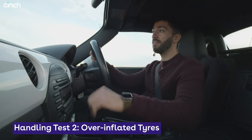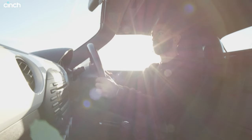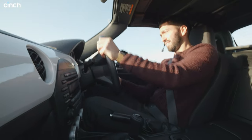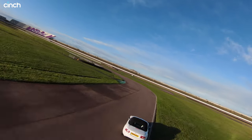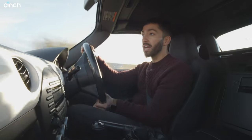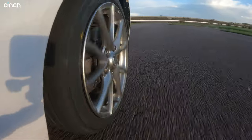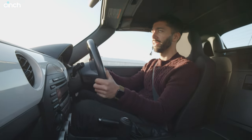Now I'm in the other MX-5 with tyre pressures at 40 PSI all round. Straight away I've got understeer and oversteer. At high speed — oh my god — that definitely feels pointier and then quite snappy. It's a bit wet here. Yeah, that is much, much bitier — that is bite-you-in-the-backside-and-throw-you-in-a-hedge territory. Very little aggravation and the back end just wants to come around. So if you're out on the road with tyre pressure set too high and you have to make a quick adjustment or take evasive action, well this is going to happen. That narrowed contact patch of the over-inflated tyre has taken away a lot of grip.